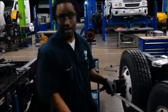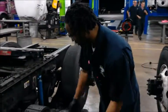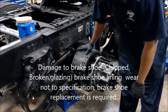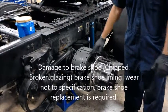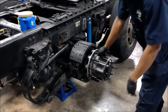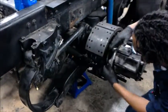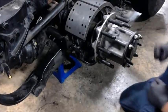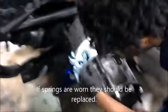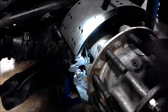This is what we call our brake shoe here. Checking those for any type of damage — any type of damage means it needs to be replaced. This one is chipped and broken. Holding the shoe together, we have our springs. These springs sit in there, and you can see that — they hold that shoe together from top to bottom.